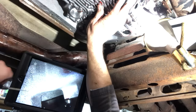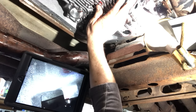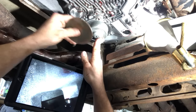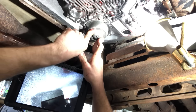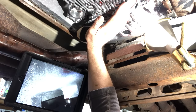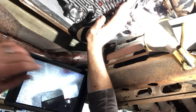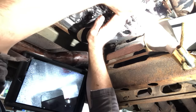I noticed a drip of fluid, so the next thing I did was take a flat piece, put it under my hand, and took the e-clip off. Now the piston is all the way up, and I can shove the rod up even further — simulating a longer rod — and with that I can't move the band at all.